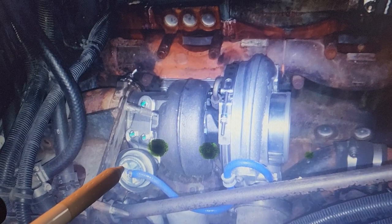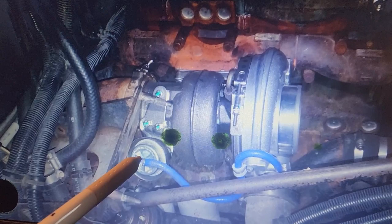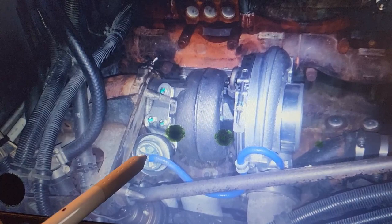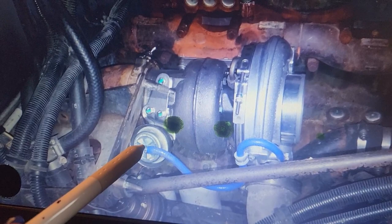And another thing, my experience with the 171702 turbo is it is a great turbo. It's fun to drive around. I had it at 600 horsepower, but I was sucking down fuel because I was flying up hills, so probably don't want to do that. I wanted to downgrade to 550 horsepower, and I realized after I did that it just lacked low end, so I wanted to put in the K31 to see what would happen.